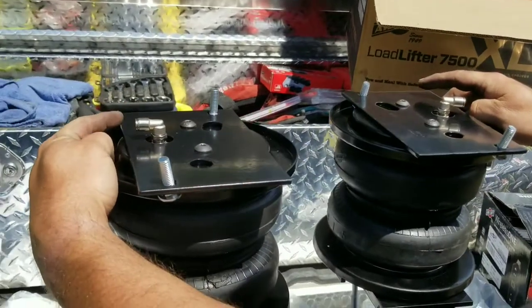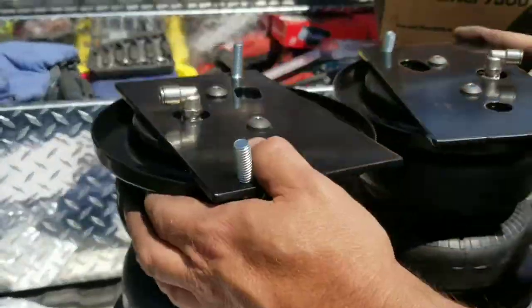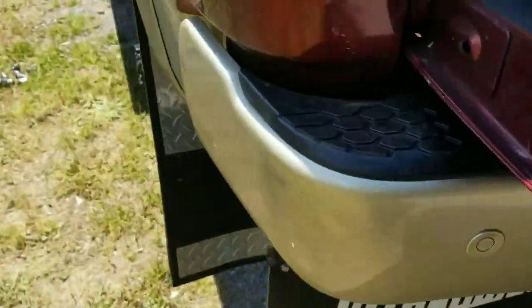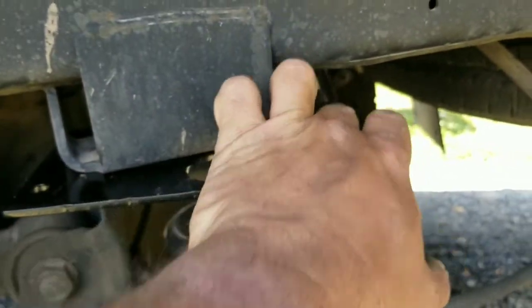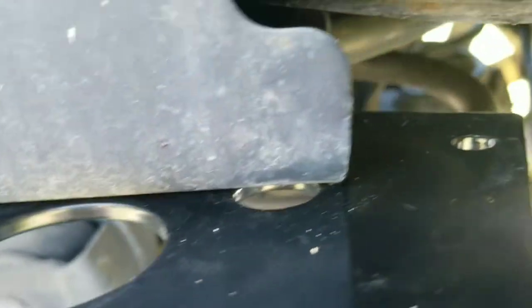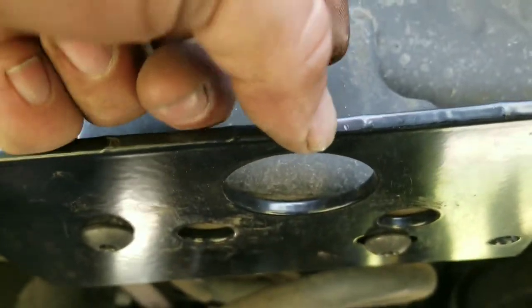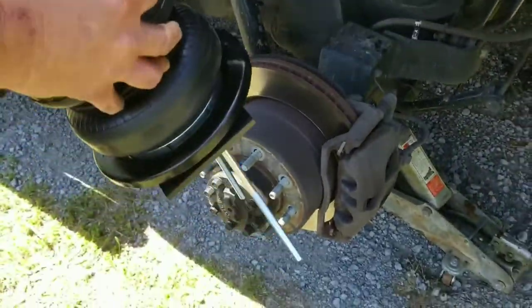The driver side and passenger side just stand there exactly the opposite of each other. Here are the factory bump stops — you do take those out, it's just two bolts and the nuts are welded. Then when we take the tire off, these plates need to go like this: on the driver side, this hole needs to go to the outside forward, that hole needs to go to the inside rear. There are two underneath that will screw into the factory nuts — they're allen head also. Make sure this hole is to the outside of the frame for the air inlet to come through. These long bolts right here will go right to the back side of that brake line bracket.